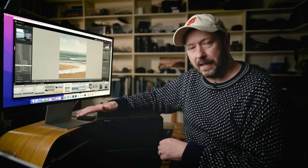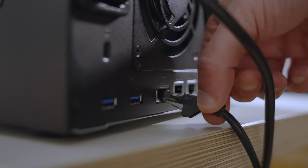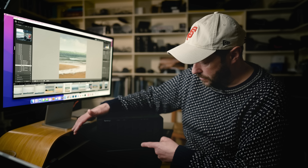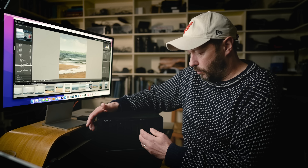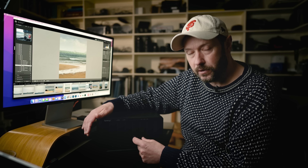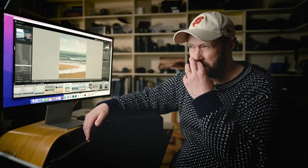So Synology kindly gave me a new NAS - this is the DS1621XS Plus. The advantage of this NAS is it's got a faster network connection. When I'm editing videos, I've got a 10 gigabit per second connection to it on my network, so I can access 4K 120 frames per second videos really fast, which is super handy. This now has five 16 terabyte hard drives in. They're really easy to plug and play. When you install it, you just plug them in and decide what type of RAID you want. What I've got is RAID 6, which means one or two of the drives can fail and I still won't lose any data. That means I get 42 terabytes of storage now, up from about 34 or 36 terabytes before.